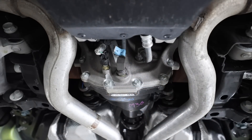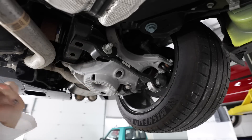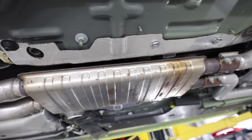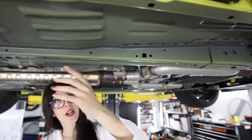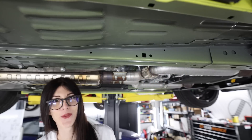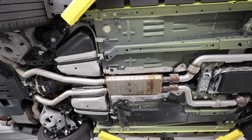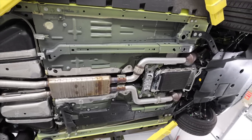You can see right here on the Torsen LSD — this would normally be your drain plug, but it goes out to your oil cooler, and there's also a level or temp sensor built into it. In case you weren't already aware, S550 chassis Mustangs have an integral-link independent rear suspension — no longer a live rear axle like previous generations. This thing has got a resonator big enough they probably wouldn't even allow it as a carry-on, yet it's still super loud. Even though this is a unibody car, I like the fact that they include a little frame rail that's spot-welded and bolted on underneath the center of the car on either side. Because this thing's Grabber Yellow, the overspray makes the underside look greenish — that's fun.